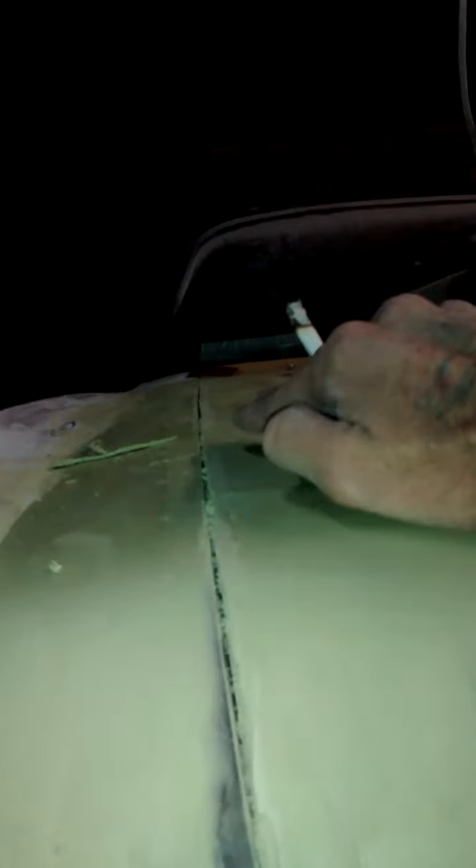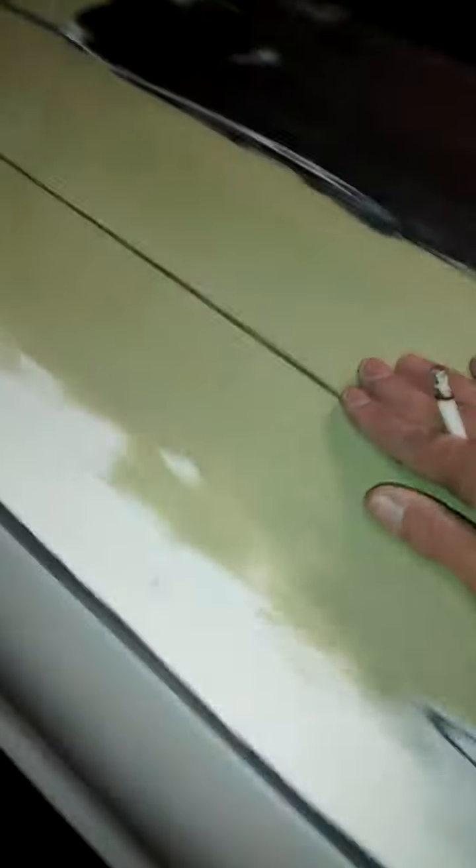As you look across the hood, they're even. It used to dip down here and go up in the air, then stick out about a quarter inch higher than the fender. So I re-fiberglassed everything so I had material all the way along here that I could actually put the hood where it needed to be. I ground it down flat — this is only a very, very thin, eighth-of-an-inch coating of lightweight filler in some places to make the body panels even.